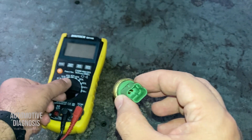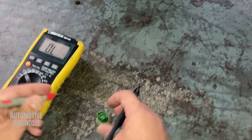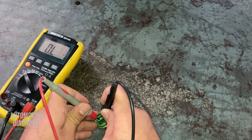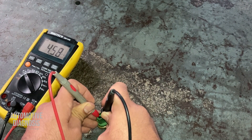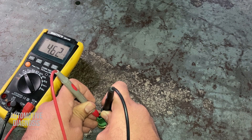First I'm going to check the sensor's internal resistance right now. I'll put the sensor here and measure across those two pins. My reading is 4.58–4.59 kilo-ohms — that's the sensor reading at normal ambient temperature.